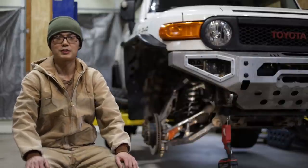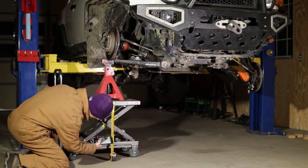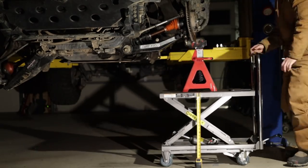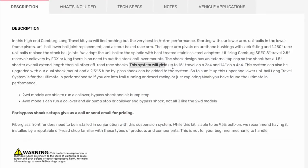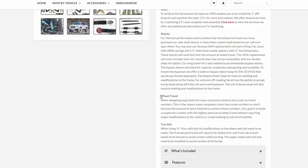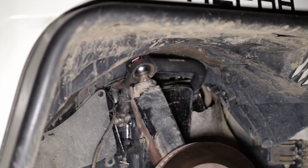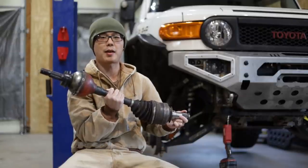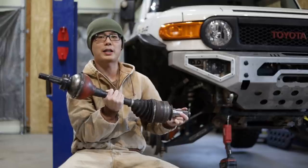First up, let's cycle some suspension. To cycle the suspension, I remove the coilover so I can jack up the tire with my hydraulic table. I also remove the limit straps and bump stops so we can see the hard limits of the control arms themselves. On their website, Camber claims 15 inches of wheel travel on two-wheel drive and 14 on four-wheel drive, which is probably the highest claim in its class. Dirt King on the other hand claims only 13 and a half inch, which is on par with the rest. In my measurement for Camber, the full droop is limited by the upper control arm uniball angle. At full bump, it is the uniball cup hitting the inner wheel well. My particular CV axles used on the Camber kit did not bind throughout the travel, so technically we should expect 15 inches claimed for two-wheel drive — but we only got about 13 and 3/16.